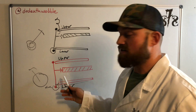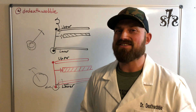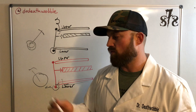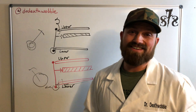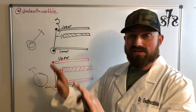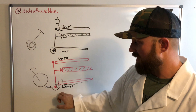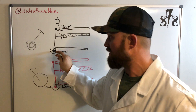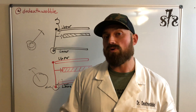This is the most basic way to look at it. There are tons of things that can cause it and we'll do more videos, but this right here is the number one thing we do at the shop all day long — fixing it by addressing the caster. Once you lift it, you're pushing the axle down away from the frame and bringing that lower ball joint back. The wheels pivot around those ball joints, so the further forward you can push that ball joint, the happier that Jeep's going to be and the more it's going to want to drive straight.